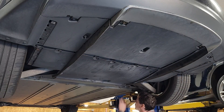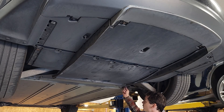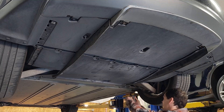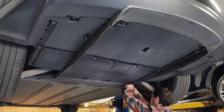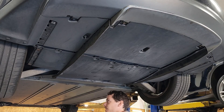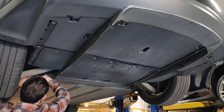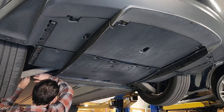The shear plates are held in with three screws that all have T25 heads, and then they're attached to the subframe bolt with a 15-millimeter hex nut. Now I can just grab the shear plates and give them a wiggle while pulling back to remove them. Like I said, not necessary if you're just doing a speed sensor check, but if you want extra access or clearance it's sometimes necessary depending on the exact spec of the car.